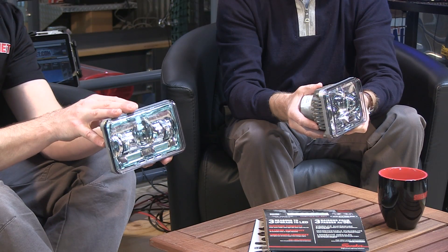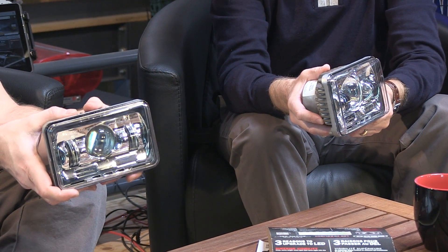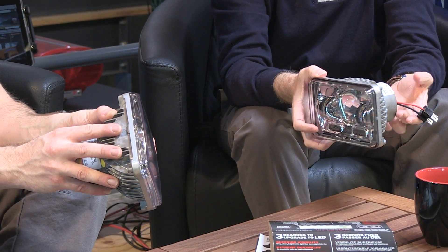Tech specs on this particular product: as Stuart mentioned, they're a 6x4, so retrofitting for your large apparatus — semi-truck, sweeper, what have you. High beam, low beam. What's nice is you have different light outputs. With the low beam, a more low-level driving light; high beam, wider, more distance beamed. As far as tech specs go, you have a 750 usable lumen low beam, with a higher lumen rating for your high beam of course. With it being LED spec, it's a low current draw. On a 12 volt system it's going to be 3.5 amps, decreasing to a little over 1.5 for a 24 volt system. So in either case — 12 volt or 24 volt — you can do the retrofit with these units. Basically they're dual voltage.